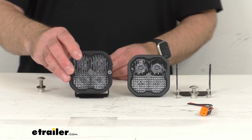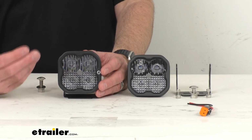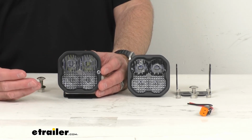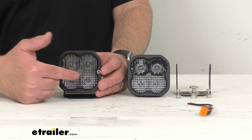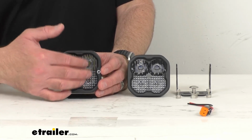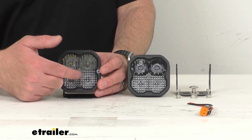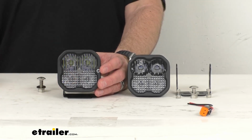And these lights are designed with a newer technology known as custom TIR optics. TIR stands for total internal reflection. So unlike the older technology that uses reflectors or simple projector lenses, which aren't real efficient at focusing all the light where you want it, this custom designed large TIR optic actually collects and then focuses all of that light forward very efficiently. And then instead of using another external lens, certain lens patterns have been molded directly into this lens surface. So that's going to prevent the normal efficiency loss you see with an outside lens.